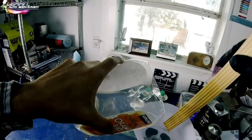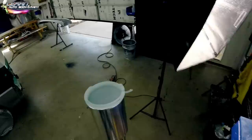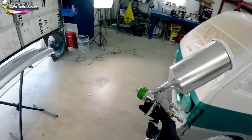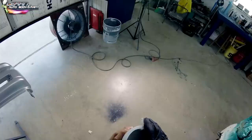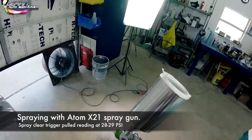We are finally mixing and about to spray our clear coat. I'm using the House of Color clear coat system, and I love House of Color — they make a very high-quality clear coat. Because this is a project I really wanted to look good, I decided to use a really good clear coat. This kit cost close to $300, probably around $280-$290. We're going to put two medium-to-heavy coats of clear on it, load it on, and we're going to be perfectly fine.